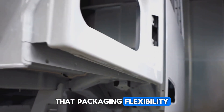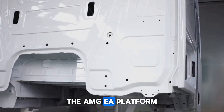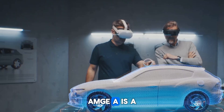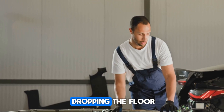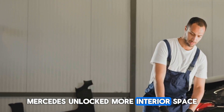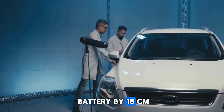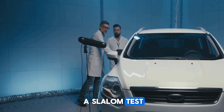That packaging flexibility led Mercedes to create an entirely new vehicle architecture: the AMGEA platform. Instead of cramming modern tech into old gasoline skeletons, AMGEA is a clean slate built around Yasa's ultra-thin high-powered motors. By dropping the floor, eliminating the prop shaft tunnel, and reducing bulk, Mercedes unlocked more interior space, better aerodynamics, and cleaner weight distribution. In real-world testing, this meant dropping the battery by 18 centimeters, cutting 200 kilograms, and gaining two-tenths in a slalom test.